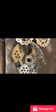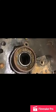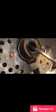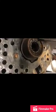the rest. Alright, now that you got everything ready, first thing you want to do is get a good place to mount this at. I got a vise, so I'll use a vise. You use a screwdriver to get this first seal out here. Just kind of want to wedge it in there a little bit and pop it right on out. You can see a lot of mud and gunk has been getting in there.